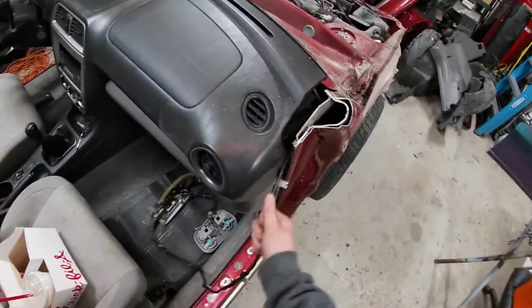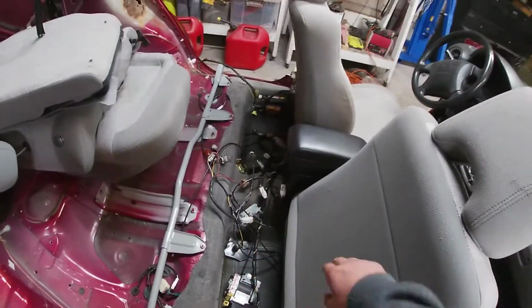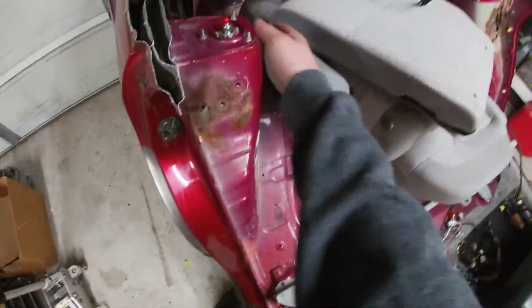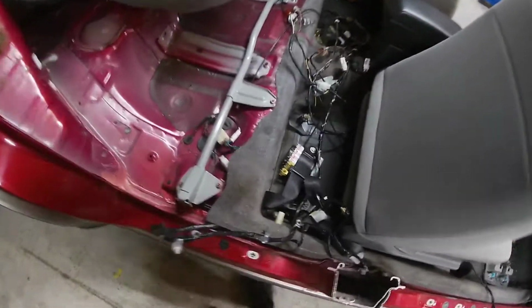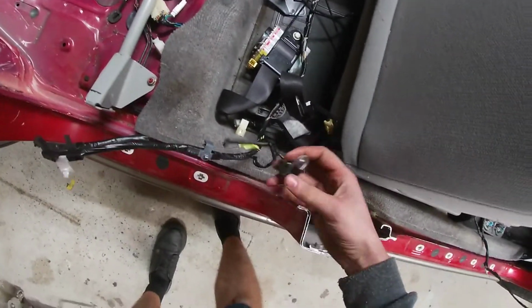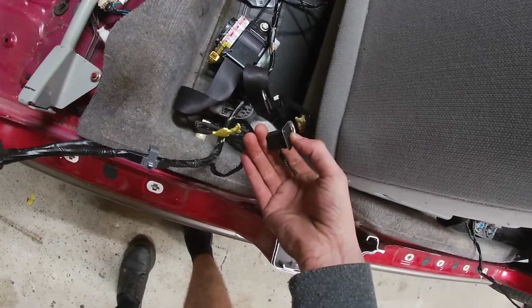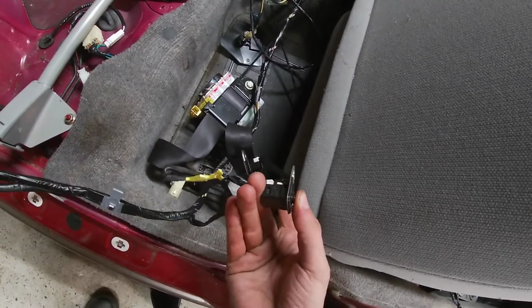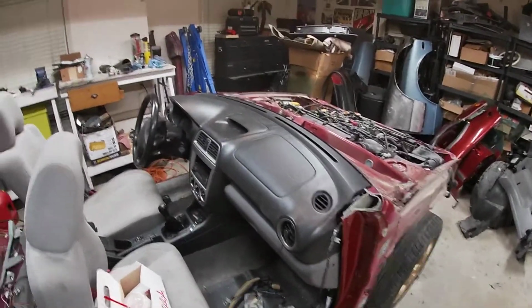Really happy with none of the wires getting cut though. Everything here I labeled what's main sides. It really just follows the one and then it splits off, but it's really easy to follow. And we'll probably end up making some boxes for the door warning on the dash. Just slide it over there, zip tie it, and they'll stay shut. That way that light goes away. Even when the car's off, that light stays on, so it'd constantly drain.